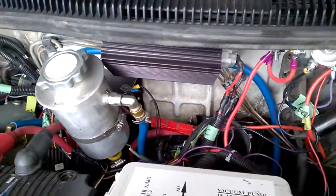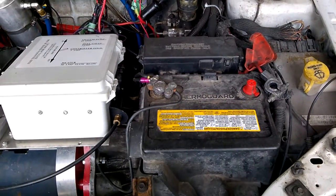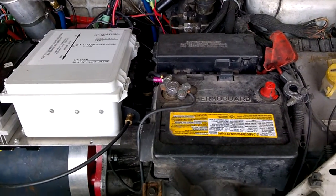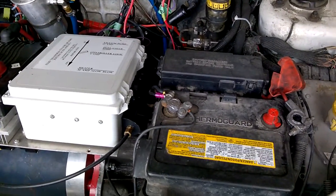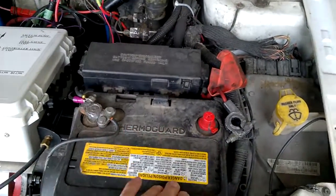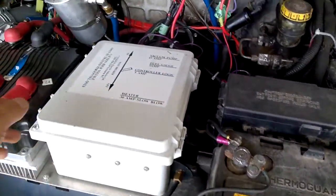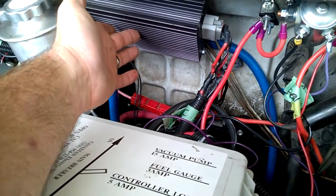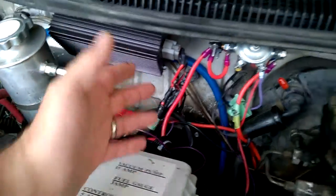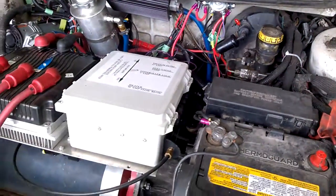You put your car battery back in, and that's just easier than trying to wire up all your accessories — headlights, mirrors, fans. Put that back in, hook it on, and then it's all live. But then you just got to charge it because you don't have an alternator anymore. So here's your DC-DC converter — it takes that main power and trickle charges the battery. And that's about it up front here.